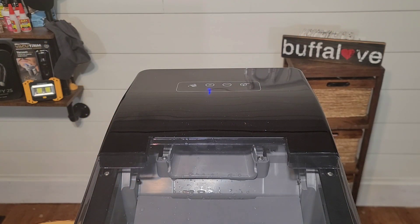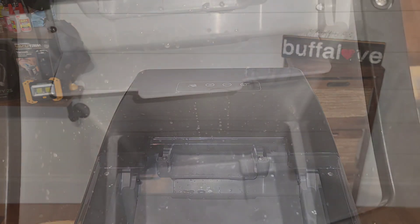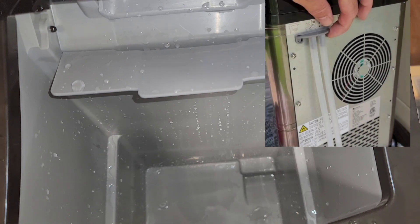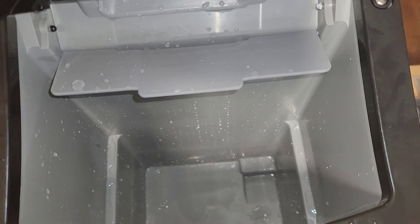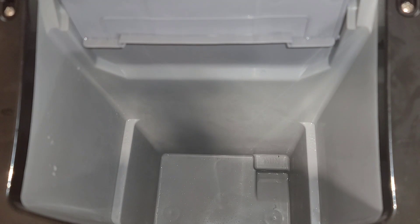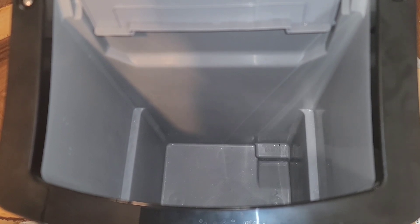When you're finished making ice and ready to put the ice maker away, it's important that you turn it off — but notice you can still hear the motor running. You're supposed to let that motor continue to run until it officially stops, because it's cooling itself down. Then clean out all the ice in the bin and drain the water using that same hose attachment in the back. I've drained all the water out. Now I'm taking a paper towel to dry up all of this water — I'll do a second pass since there's still some water remaining. I leave the back tube open in case I tilt the machine and more water goes to the drain. You want to get this completely dry, especially if you're not going to use it for a while.